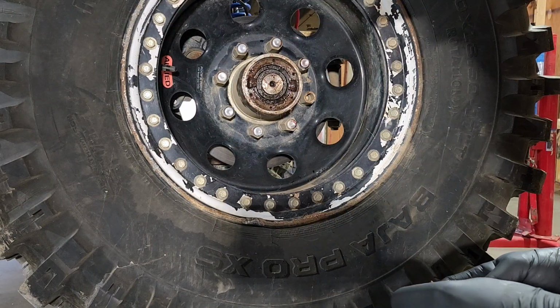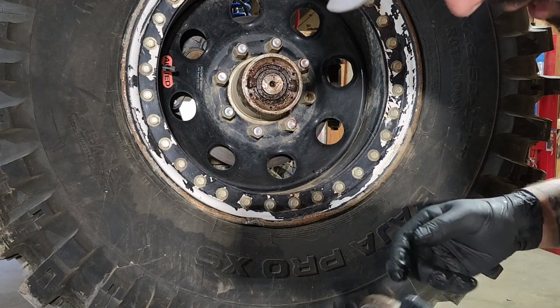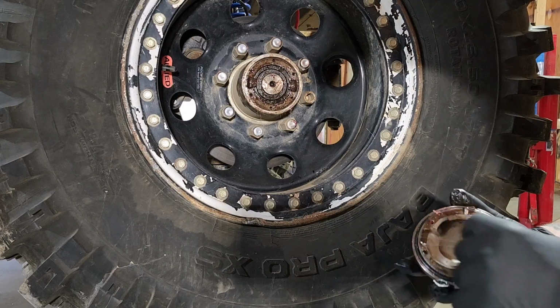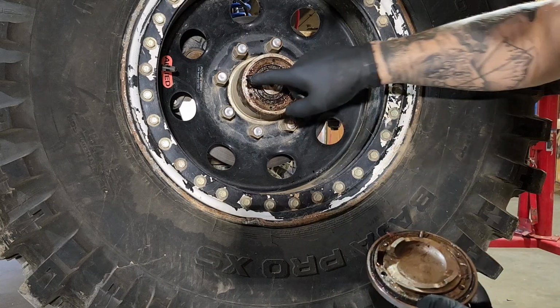This goes like so. You have to put them on the lock position. See, it's going to say lock because you want to align that hole with these cam lobes.